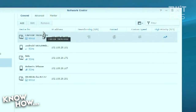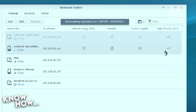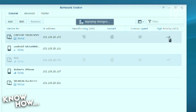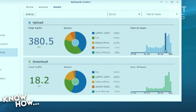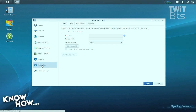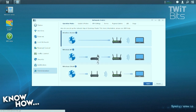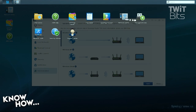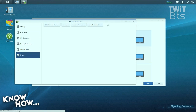For admins who want a little more control, Synology SRM also allows you to prioritize traffic from particular devices on the network — perfect for mission-critical devices — and it gives you up to a month of recorded traffic stats, letting you sort through the top talkers and applications on your network. These settings and more allow you to easily configure your RT-1900AC for router, AP, or client mode, turn on sharing of media connected to the USB port or SD card reader, set up SMS notifications for network events, self-signed certificates, and dozens of features that most users won't care about, but geeks will love.